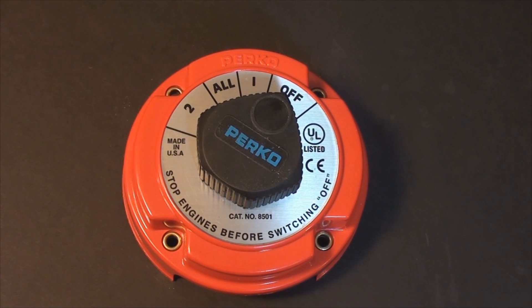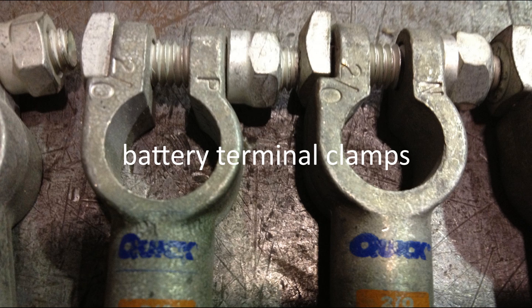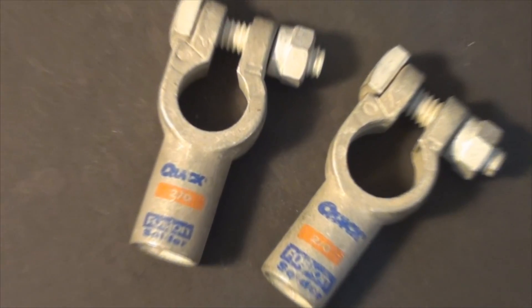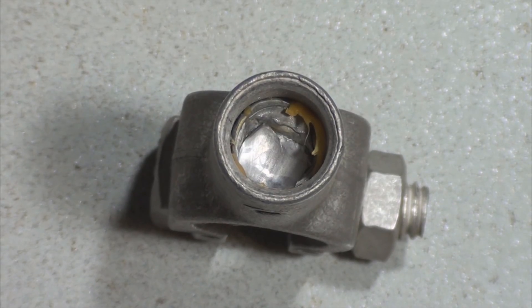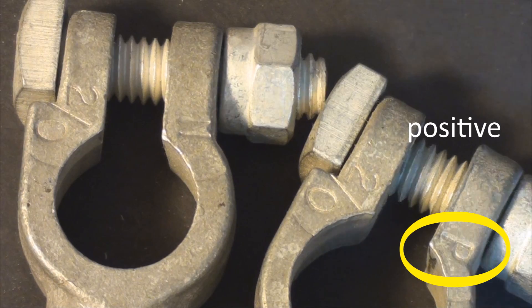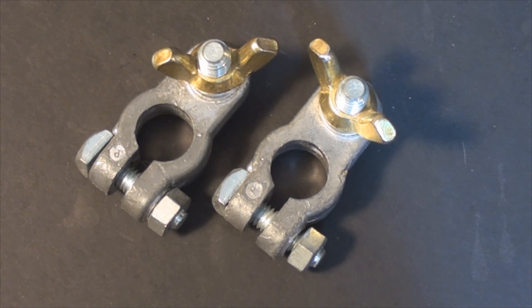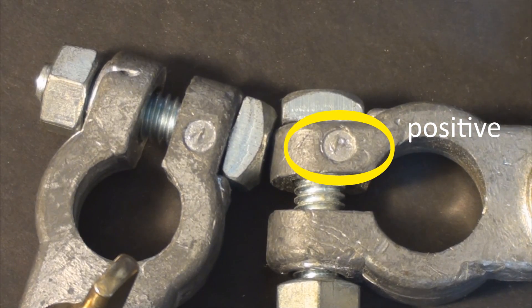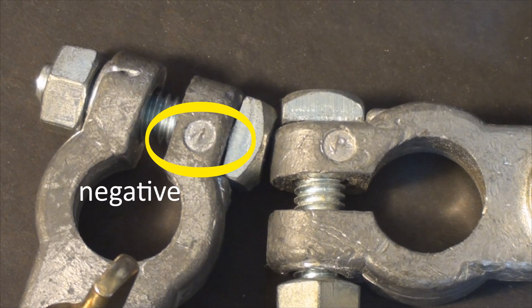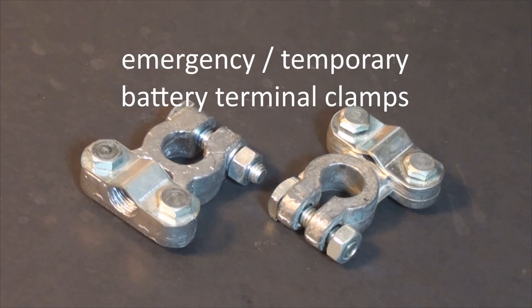Collect all the gear you'll need to change everything that is at all questionable. If you use battery terminal clamps, you can get this type that comes preloaded with solder and flux. I find them difficult to crimp neatly and I prefer battery terminals to be crimped and soldered. These adapters are used when your cables don't match your battery — make sure you have both a positive and a negative.